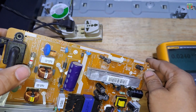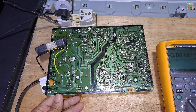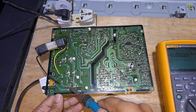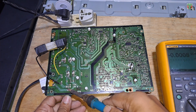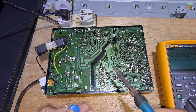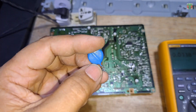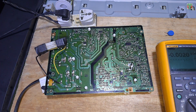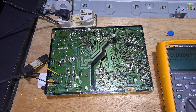As mentioned earlier, we can convert the TV to 220 volts. We will only remove the MOSFET and remove this varistor. A varistor, also known as a voltage dependent resistor, has a limit voltage. A 120-volt power board uses a varistor rated at about 150 volts, so we will remove it or replace it with a varistor of about 400 volts. With power factor correction (PFC), the voltage on the main capacitor is approximately 380 volts DC.